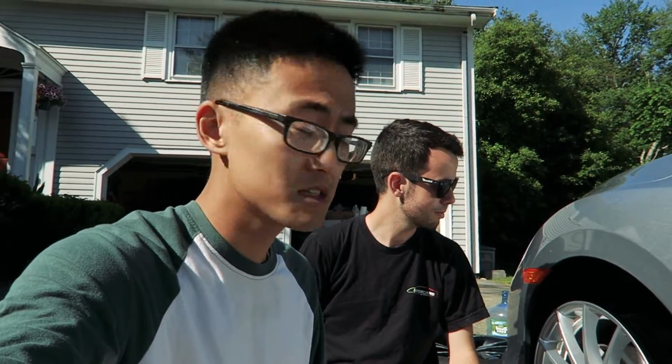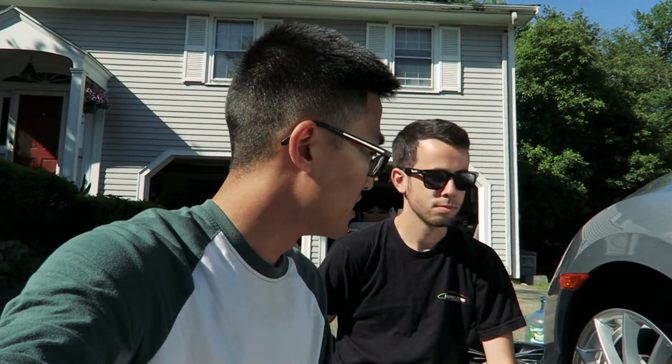Definitely. So we'll catch you guys in the next video, where hopefully we'll be putting tires onto these wheels, mounting them, doing a final test fit, and finalizing it with a new set of lug nuts, because right now I have ball seat lugs, so I'm going to get ones that are conical to match the wheels. It's going to be a good time.